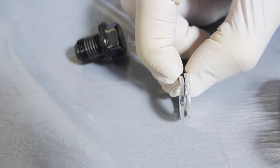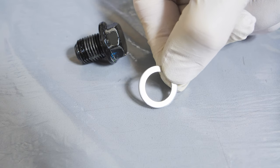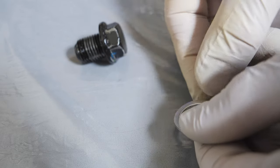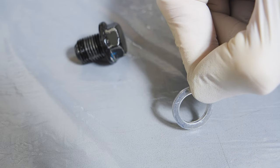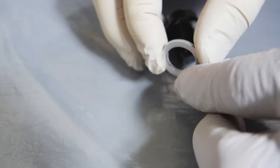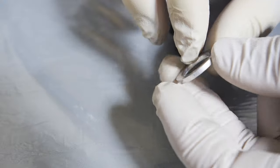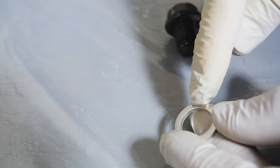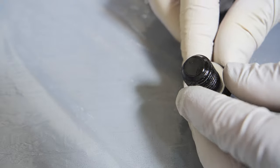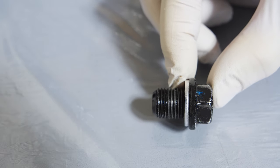You can see here that the difference between the new one and the old one — there's not much difference. Here's the new crush washer we're going to be using. Also, if your old crush washer has any sort of indentations, then you'd want to get a new one because that could lead to leaks. You want to make sure that you use the flat side toward the oil pan to mate with the pan, and the rounded side to mate with the bolt — that'll give you the best possible mounting surface.